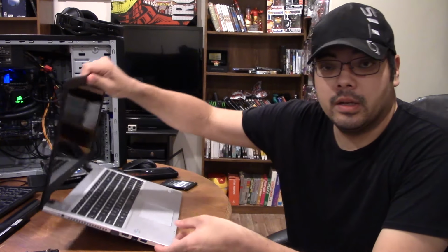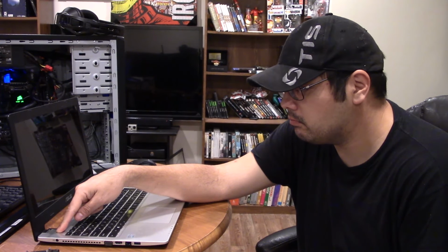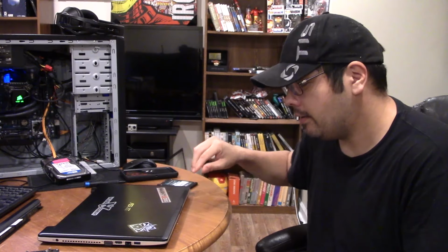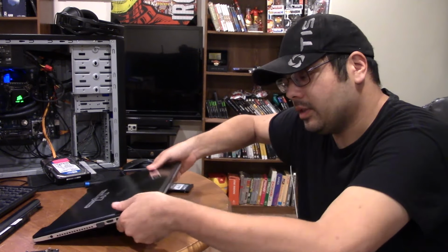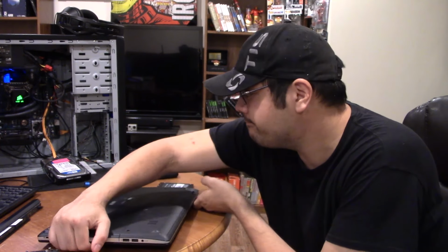Okay, computer is definitely off. I've taken the battery out. You want to make sure that you discharge it. You never know what the capacitors might be doing in there. So just go ahead and hold down your power button for 5-10 seconds. You can hold it down longer. It's like planking for your finger. Okay, I'm satisfied that it is discharged. I do still have to take the stickers off the front. They aren't bothering anything, so.